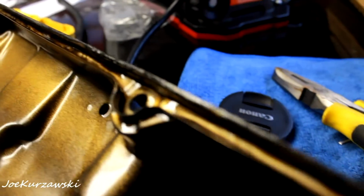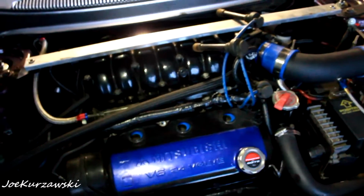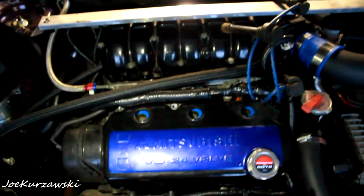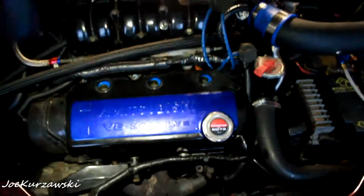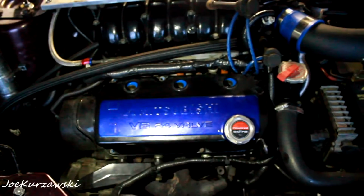Old gasket on the floor. There's the spark plug tube seals. I didn't touch this yet, but you can see that oil all inside that groove there that was leaking by. Alright, losing daylight, so I'm going to stop for today. But got the tube seals on, got the gasket on, just set that on there so nothing would fall in those valves. So we'll pick it up tomorrow.